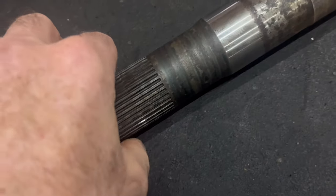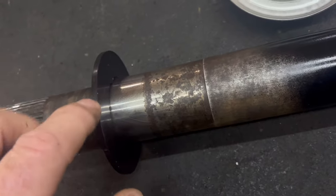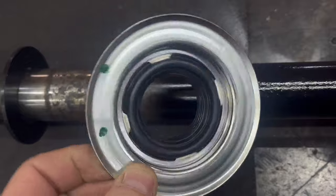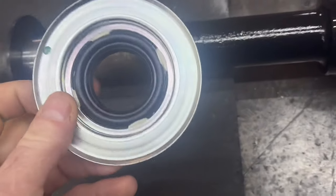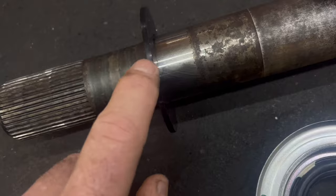I really like to have these on — I feel a lot of people probably do not put these on. These are just little helpers to hold the axle up just for install. These don't hit anything when they're running, just so we can install. In order to do that we're going to have to put this on here, then put that behind it and slide the whole axle in through the knuckle, and then get this seated in there around the axle. It's kind of a little tricky but that pretty much explains it. It's very convenient to put this in first, very inconvenient to have this though.